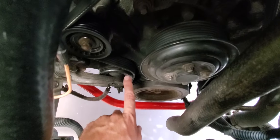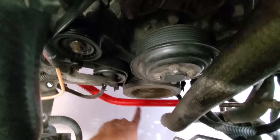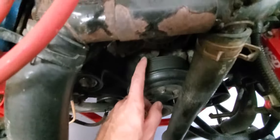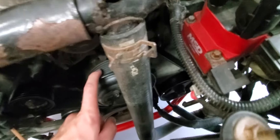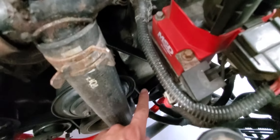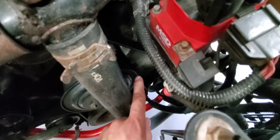After the tensioner, the back side of the pulley goes on the tensioner, then it goes down around the crankshaft. Once it goes around the crankshaft all the way, it comes back up and then it back-sides on the harmonic balancer. After it comes around that, it goes back down to the power steering — you can see down there — wraps around the power steering and comes back up to the alternator.